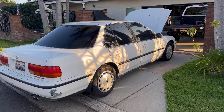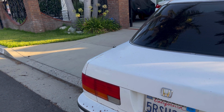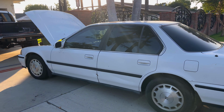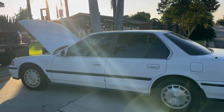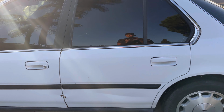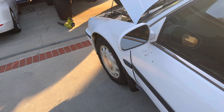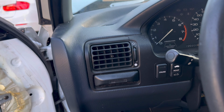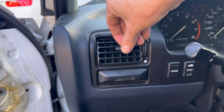All right, now that we got it all wrapped up, we've got four wheels and they match, which to me is amazing because I hated how it looked with the other mismatched wheels. But now there's mud guards on all four corners. Those were there already. We added these as a factory option. I did have to change the radiator cap because the hose was collapsing and that's one sign of a bad radiator cap. And I got this little guy from the junkyard when I got the wheels.